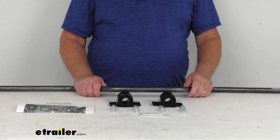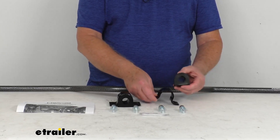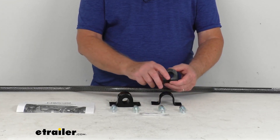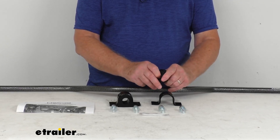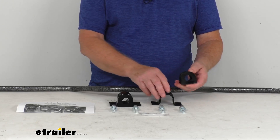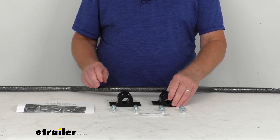This one here comes with the polyurethane bushings, and the polyurethane bushings are used instead of the standard rubber variety to give you a longer-lasting system. The polyurethane itself is durable and resistant to damage that can be caused by oil, gas, and ozone, and of course less wear means less give in your system and better support.